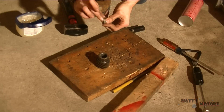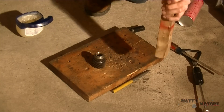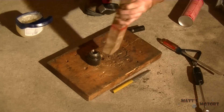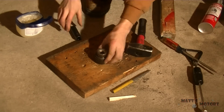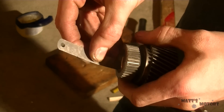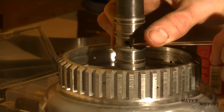Lubricating the gear inside and the bushing so it goes in easier. First use a piece of wood to get it flush - it's the easiest way - and then a socket or something else of the same diameter to get it in and check how far down it is.